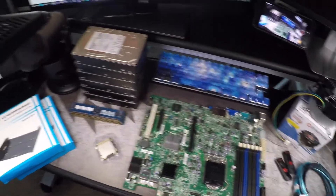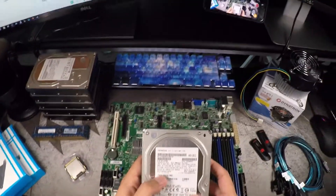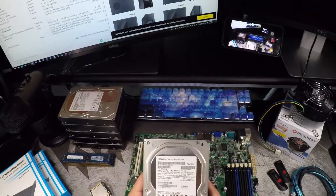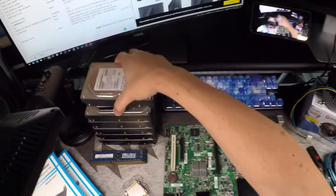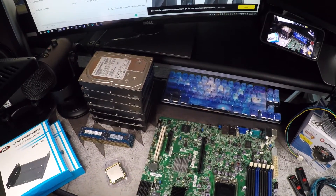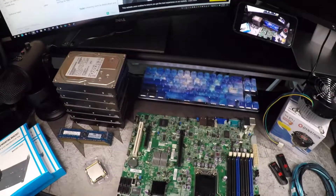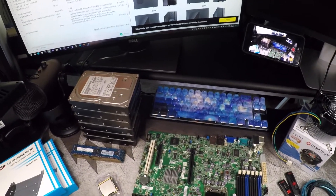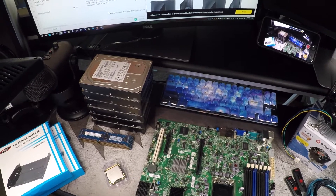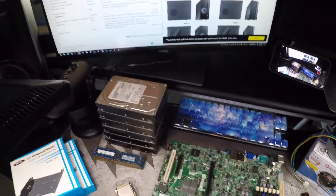Speaking of hard drives, there are six refurbished Hitachi 3TB drives. I got these particular ones from Refurb4Less on eBay — $49.99 each with free shipping, so $300 in hard drives total. Six drives gives us 18TB raw. We're going to be doing RAIDZ2 in FreeNAS, which is essentially RAID 6, so we'll have a little bit less than 12TB usable all said and done, but we'll have two-drive failover and two-drive parity with Z2.